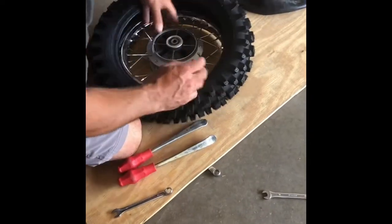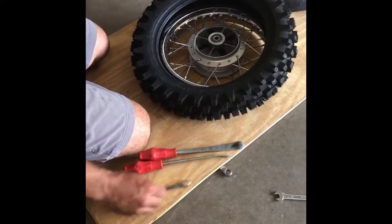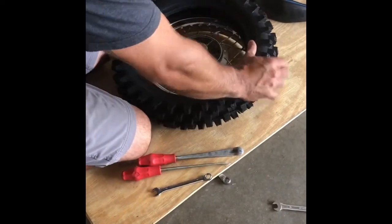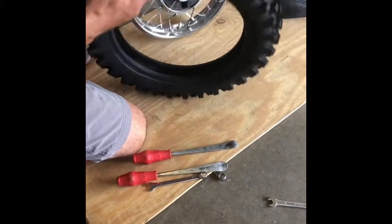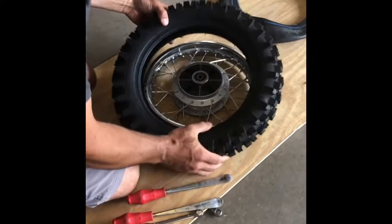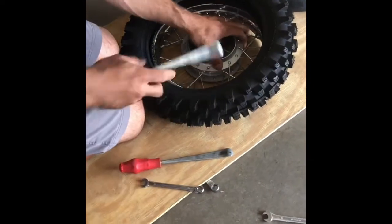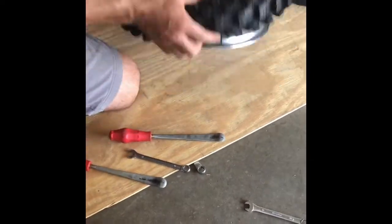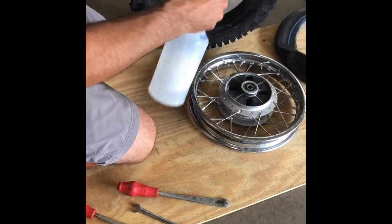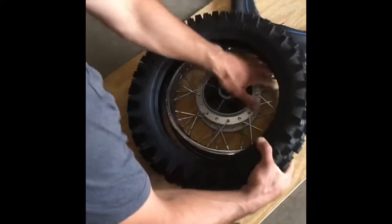We're putting the tire back on — this is the hard part, just even getting it started. I've got my two spoons here and maybe a wrench for a third one — that way it doesn't pinch anything. If the tire is directional, you want to make sure that you got it going the right way. I like to do it on the ground where I can push my knees into the tire, and that helps you get a little bit more slack when you're putting the tire on. So we've got our soap and water here — I'm going to soak this up right here to help it slide on. I know they say use some kind of rim wax or something, but I don't like spending money.